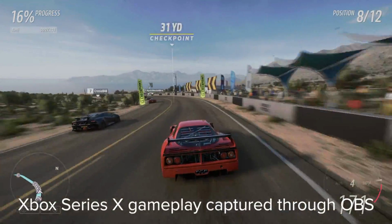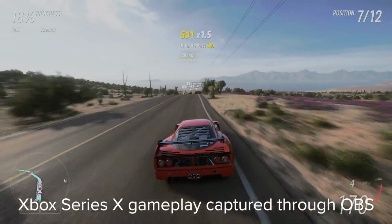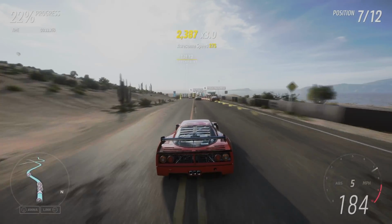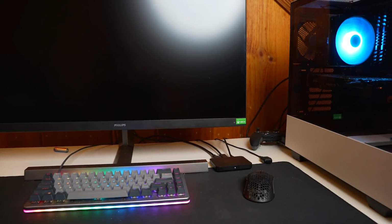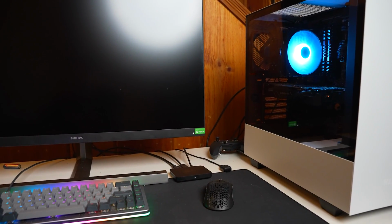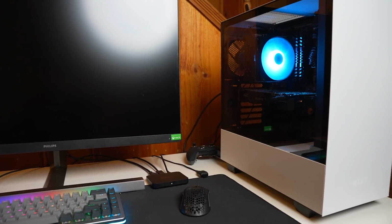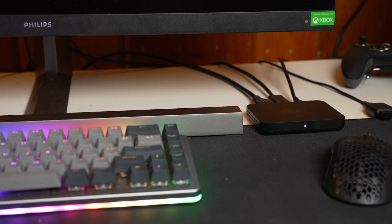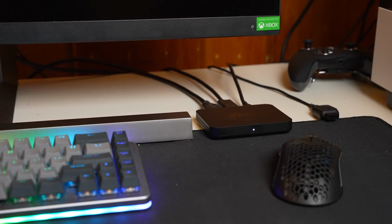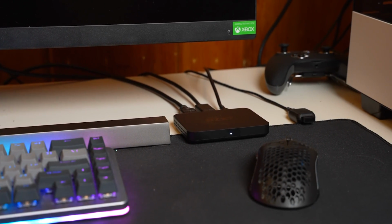Like when you plug in a USB camera, you can select that input source in your video software. That's kind of the same thing that this capture card will do. Sometimes they're internal PCIe cards, but these from NZXT are external and run off of a USB 3.2 Gen 1 connection. Capture cards can also be useful to take the HDMI output of a video camera and use it in stream if the camera doesn't natively work as a USB capable device.